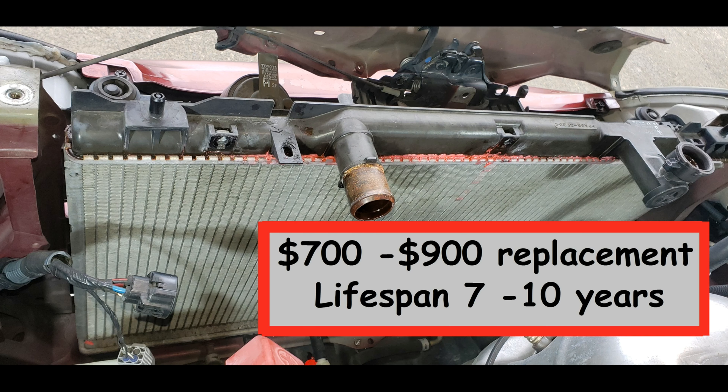In this video, I'd like to show you how easy it is to replace the radiator on a 2004 Camry. To have a shop do this job for you, you're looking between $700 and $900. According to the internet, the lifespan of a radiator is between 7 and 10 years. Since my Camry is 18 years old — good job, Toyota! The reason I knew this was bad is because I had to keep topping off my radiator fluid; there was never a puddle. It was leaking through the top seam and evaporating — and you can't see that seam normally. You have to use an inspection mirror to look at it.